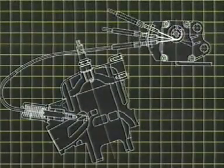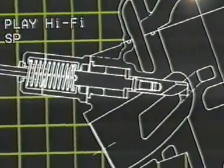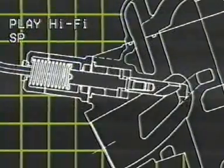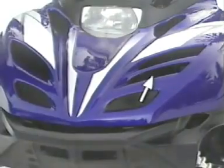Take the SRX's new electronically controlled exhaust power valve system. The system's onboard computer adjusts power valve opening to match engine RPM, providing optimum exhaust timing and maximum power across the rev range. Unlike competitive designs, Yamaha's power valves are self-cleaning to maintain optimum performance. Sleek SRX bodywork reveals cutting-edge, form-follows-function design. Stylish intake ducts are the outward indication of a highly sophisticated air management system. Air to cool the brake system, muffler, crankcase, and clutch passes through these louvers.